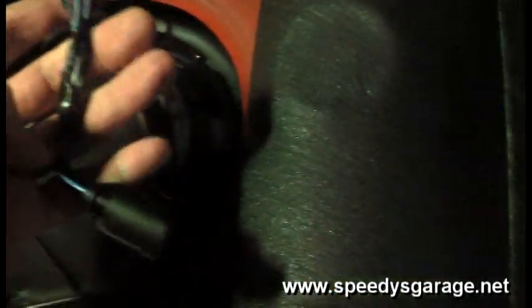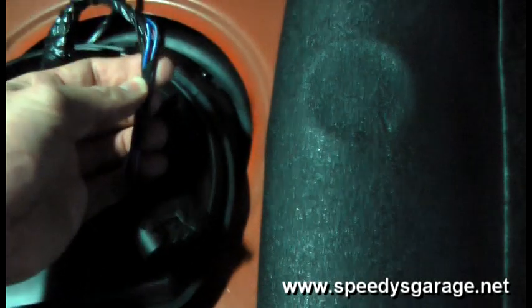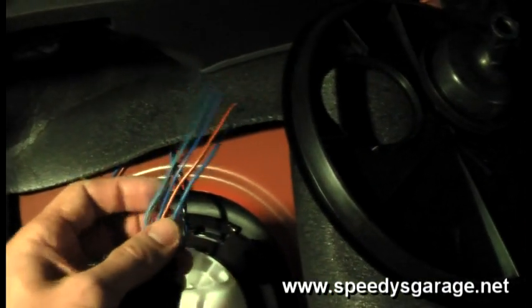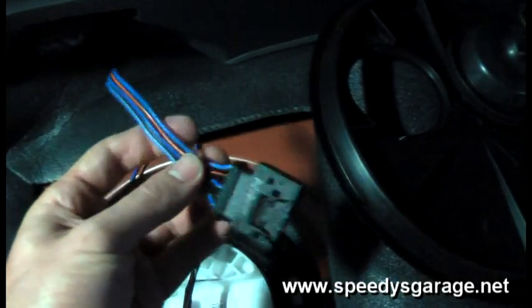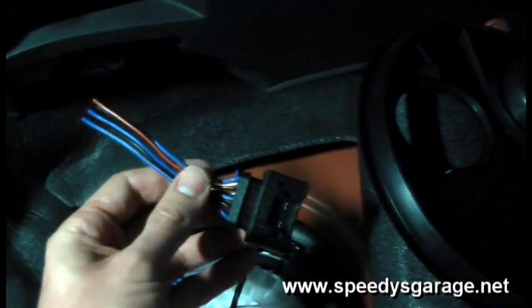Remove all the tape back underneath the foam and remove the rubber grommet to access the wires. We need to cut this plug off and solder on the weather pack plug that goes to the fuel hat. I've cut the factory connector off — don't panic about this. If you ever wanted to go back, all you do is strip off a little wire and solder this back on. I gave myself about 4½ inches of wire on the end of that connector just in case.